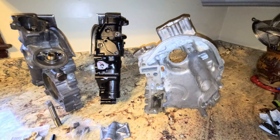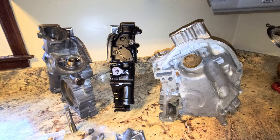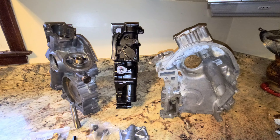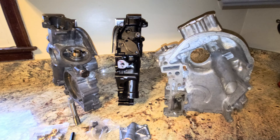I ended up having a bunch of them brought to the machine shop and had them media blasted. Well, I didn't do my due diligence cleaning the timing covers, and some of that media got left in the timing cover and it wiped out the bearings on the motors. So I've had a couple motors fail because they lost oil pressure and I couldn't figure out why, until I started tearing down these timing covers and I started realizing what was going on.